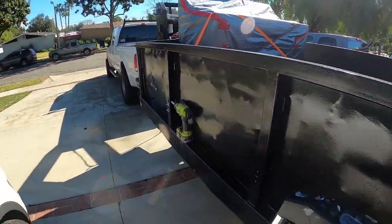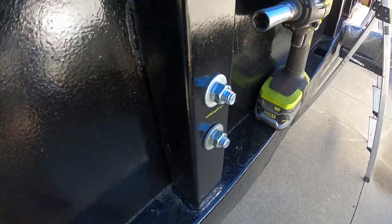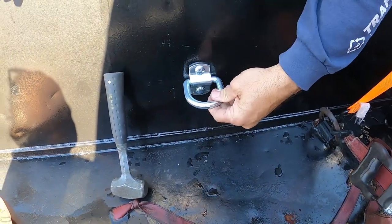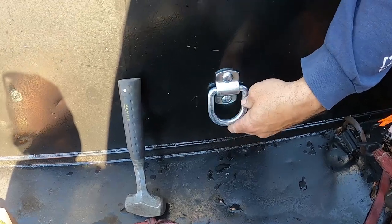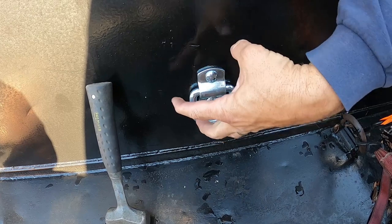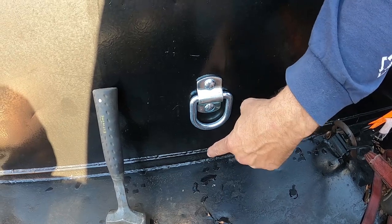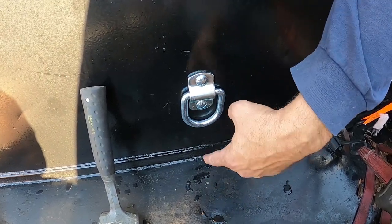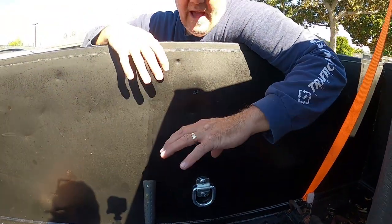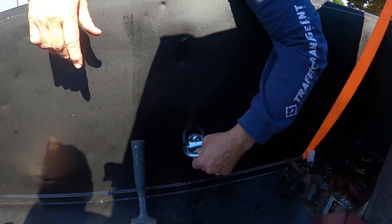Here we go — we've already got one installed right here. I had to go three inches with the nickel-plated carriage bolts. Here's the D-ring right there and I can tie anything I want down to that thing. It's super strong because I tied it into the main support and not just into the sheet metal. There won't be any flex on this. I did go a little bit lower so the strap can go up and around, and also to have it closer to the bottom where there's a little more support, more rigidity in the frame. I didn't want to put it up high and be pulling against the wall and collapse or bend the wall in any way. So I tied it into the support of the wall and we're good to go.